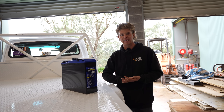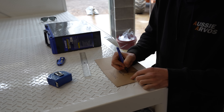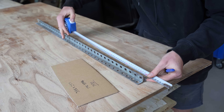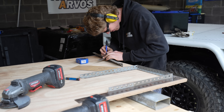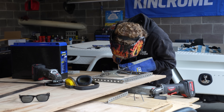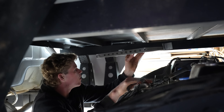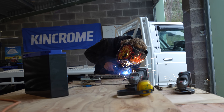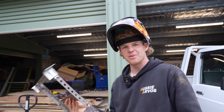We're going to start making up some mounting brackets for this thing so we can get it fixed up under the tray. A huge benefit of lithium batteries is their reduced weight — this slimline battery only weighs about 11 kilos, so I felt pretty confident making a battery tray that could easily support it. I wanted to make sure the tray was a snug fit around the battery so it can't vibrate and move about once it's mounted. I'm planning on using high-gauge tech screws to mount the battery tray, as welding brackets to the ute tray without removing it would have been very difficult. A grinder and paint makes me the welder I ain't.